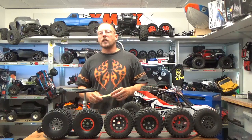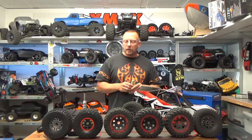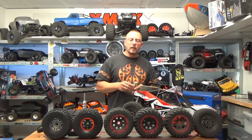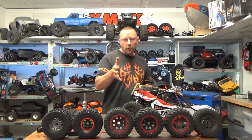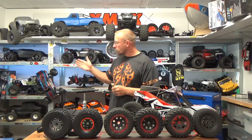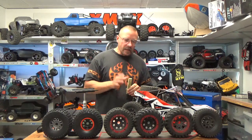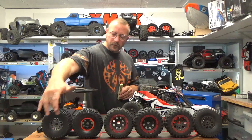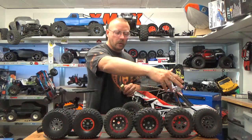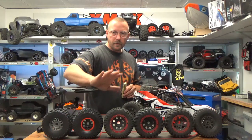Hi guys, it's Mark from DSCG68 in France. We're going to do a little video about 1.8-scale Desert Buggy tires, but these also fit 1.7-scale short course cars like the Arrma Mojave or the Traxxas UDR. One small difference on the UDR is that Traxxas has splined wheel hubs with a 7mm hole in the front, while all of these tires have 10mm holes. To put these tires on the UDR you just need a small washer in the front — that's all.